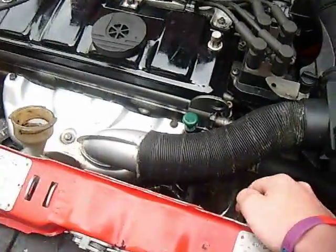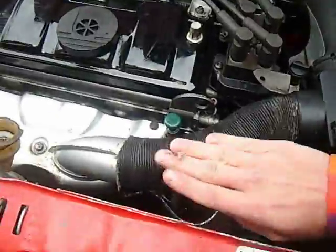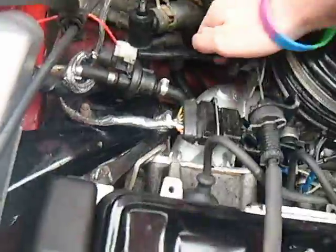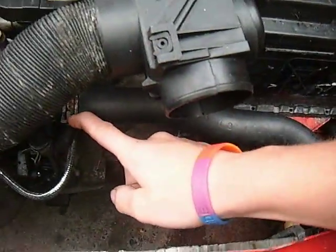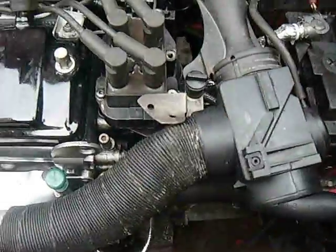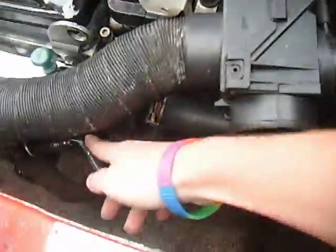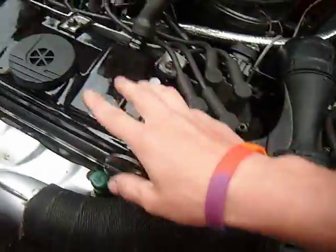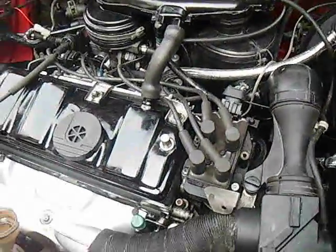That will drain the coolant that's in your engine block, because your highest point of cooling in the engine, well, for pipes going in now, is just under the manifold, so it's head level, and then your other pieces here, so everything below the head is basically in a bucket. You need to be able to get it out of the bottom, and that is where it is. If you just disconnect, if you leave that in, you'll drain all the water from your head, but you'll leave big puddles in your block, so it doesn't get everything out.